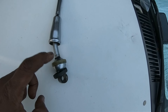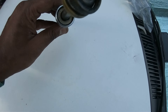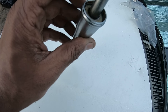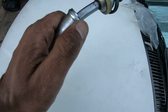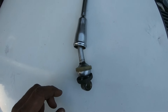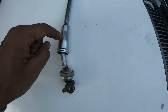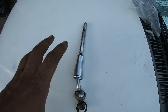To get those three pieces — the C-clip, the metal hat, and the spring — out without damaging them, you have to take the C-clip off that's inside here. It looks hard but it actually wasn't too bad; it took me all of a minute or two using a small flat-edge screwdriver. There's a C-clip that sits inside this channel right here that has to be removed. Once you remove that C-clip, pull hard at the bottom piece and it'll come out, and then the C-clip, metal hat, and spring will just slide over the top of the rod.